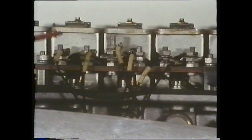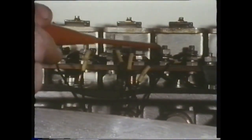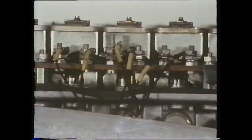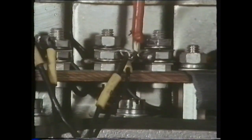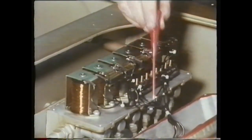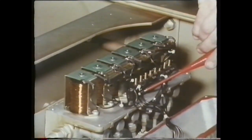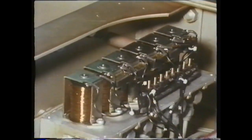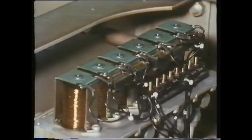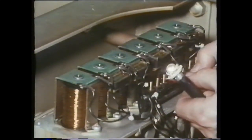Again, it's important that a check is made on all electrical connections. Are they secure? Are they clean and free of corrosion? Particularly on early EP units, ensure that if any connections are loose, no two are in contact — for this would cause the two-gear trip-out in the change speed unit to isolate, with the result that there would be a two-gear loss on the vehicle. Here, on the six-way EP units, each of the wires from the electrical inlet plug has an identification mark. These identification marks correspond to those on this terminal board. Therefore, to ensure that there is continuity from the inlet plug to the terminals, select second gear and place one lead of the test lamp on the neutral terminal and the other on the terminal for second gear. If the bulb lights, you have an electrical supply from the change speed lever to the solenoids within the EP unit.